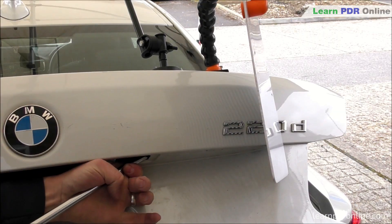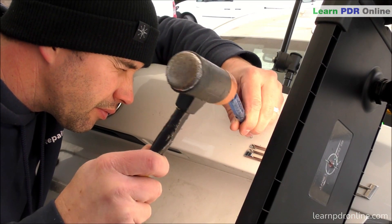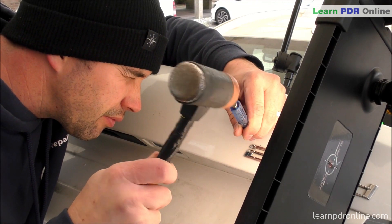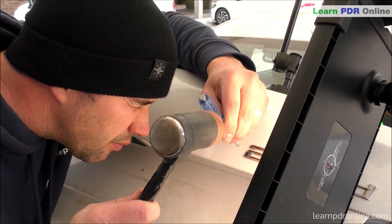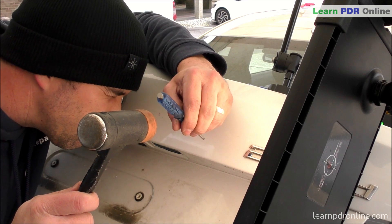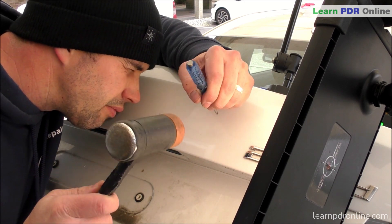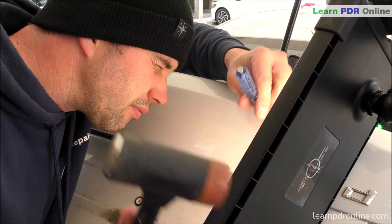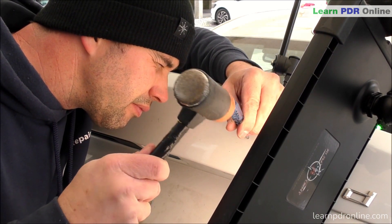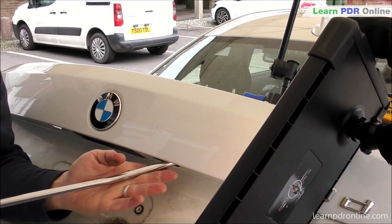Now I'm a few hours into the repair process and everything starts to get tested - a test of patience and endurance working through the process, but also a test of accuracy. Whilst I'm still working relatively quickly, I need to be accurate with each push and each tap down. If I spot some tension towards the edge of the panel as it folds round, I'm looking to tap that tension in and push that metal in towards the lows, whilst also continually working on any tension that was created in those initial crowns.